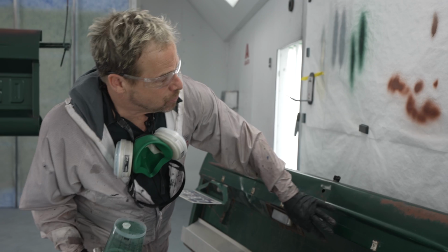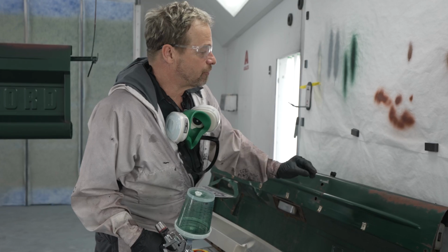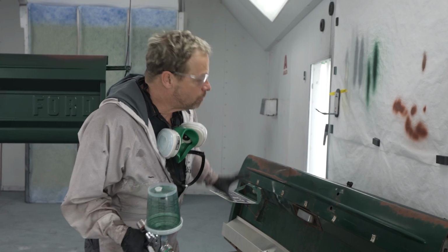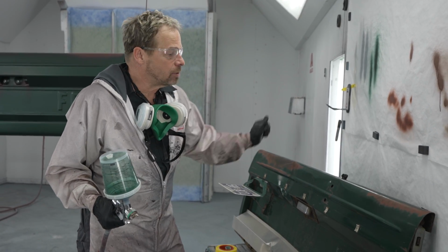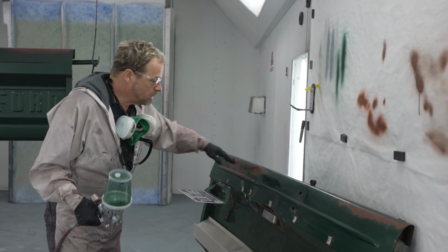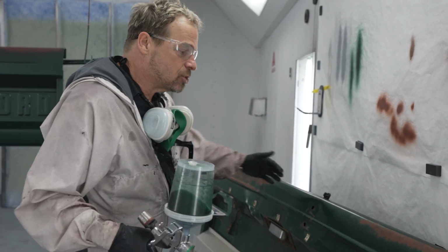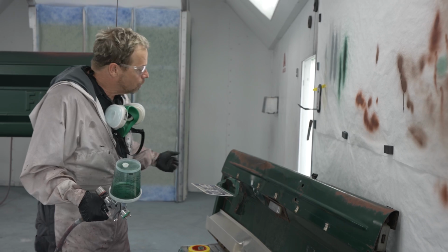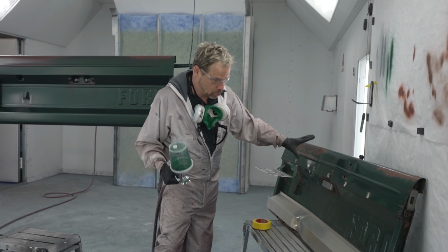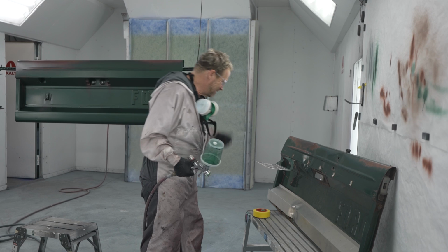The clear is half shiny, so this is more like a satin clear anyways. So we're going to start with the satin clear and brighten it up with a full clear, but it's flatter right here. So what we're going to do is called a two-gun method. I'm going to clear the panel so we have protection from UV and it's strong so you can touch it, and then I'm going to come back and style the flat clear over top of our patina places to make it look a little bit closer to this, because this is flat, that's sort of halfway shiny, and it's inconsistent all the way around. So we can really play with it from here and continue to build on the dimension and depth of what took 60 years to occur here in about 2.5 hours.